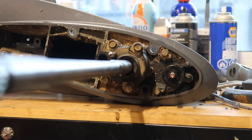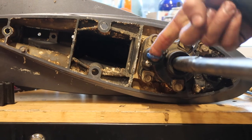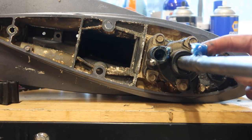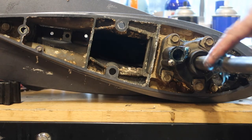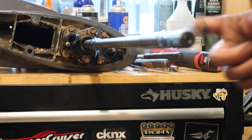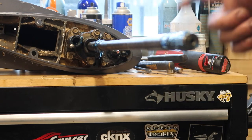With all those snugged up, take some grease and put it on your shifter coupling on the splines. Also take some and put it where your water tube attaches right here — it'll help it slide in there. We're also going to put some on the shaft right here where there's a bushing. Put some on there. Also go to the end of your shaft and put some on the splines up here, so when that shoves up through our oil pump and into our engine it'll be a lot easier to slide in there.